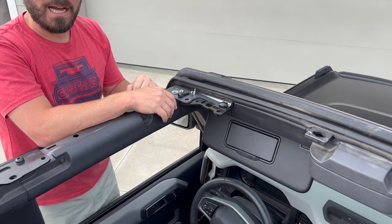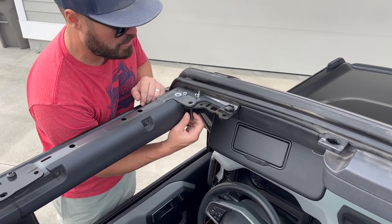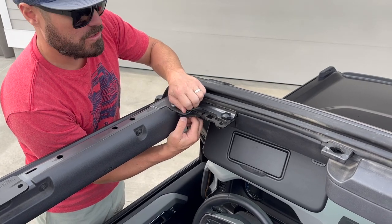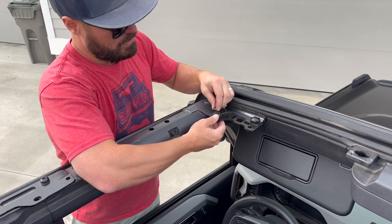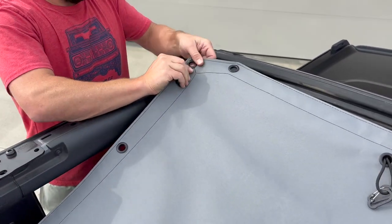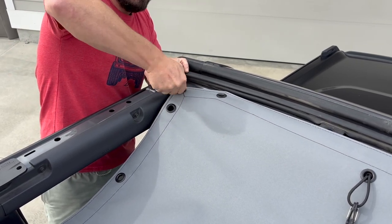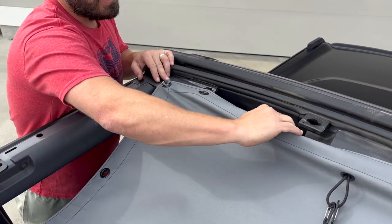On the opposite side, I'll discuss the optional DIY post, which is a 35mm M8 1.25 bolt you can get at your local hardware store. Screw that up through the bottom. These are all permanent installs — there's no need to remove these when putting your hard top back on. Do a washer, then a jam nut. Take the front corner of our Bimini and stretch that over — it'll be a tight stretch. But you'll find that when you put the wing nut on, it will actually self-center the Bimini on that position. If you wish, you can do the same installation on the opposite side.